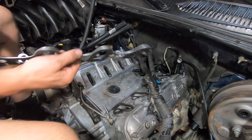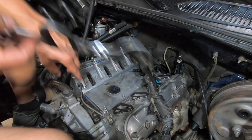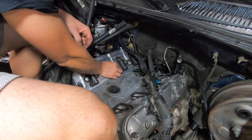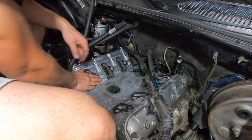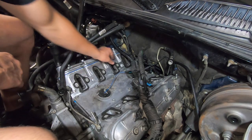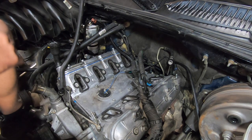This gasket — the surfaces are nice and clean. It has these little tabs here that sit over this bolt and that bolt. Get it in place and then just push it in and down — so that's how these sit on there. If you have the other style gasket, they'll just clip onto the bottom of the intake.